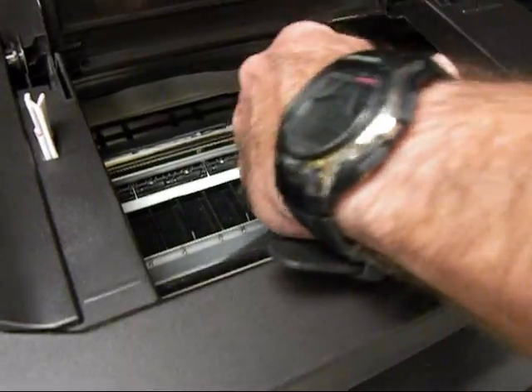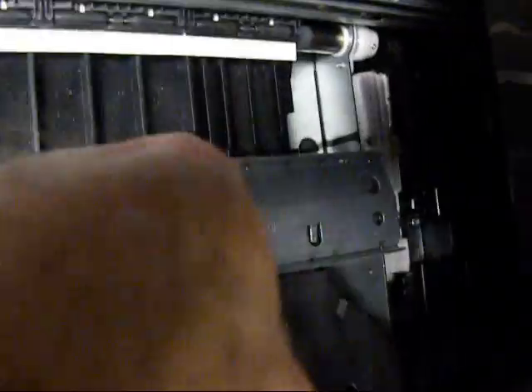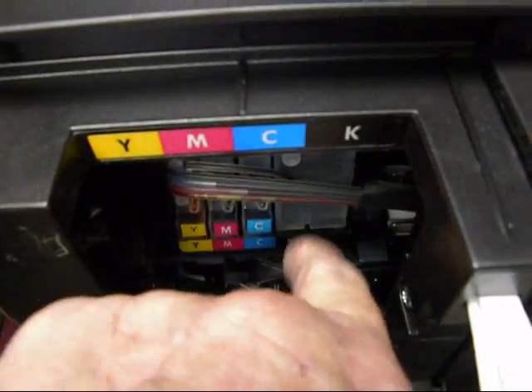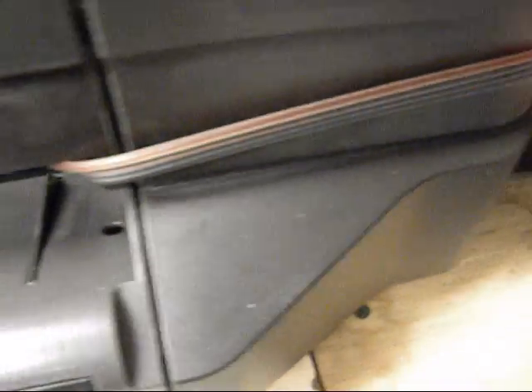Make sure the hose is not twisted. Now we're going to peel the tape and stick it down in that spot. It's very difficult to see because you can't get the camera in there. Now we've got it in — and there's one more down here. That one you can stick on ahead of time and just clip the hose to it. Notice we've got it nice and straight with just enough hose travel. Too much hose travel is going to cause it to wrap up, so you want to make sure this area is right. Got your hose clamp on. Now we put the other one on in the back, and we're going to put another hose bracket on the side to hold that hose.